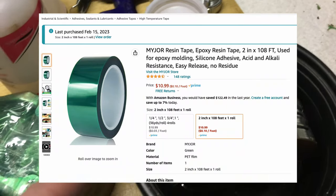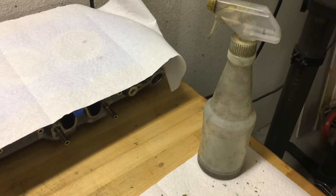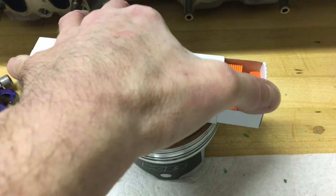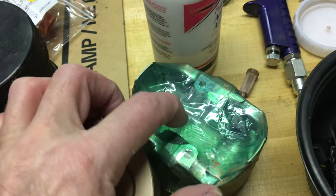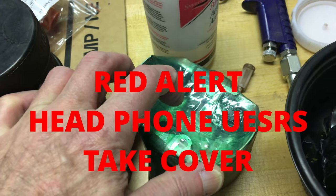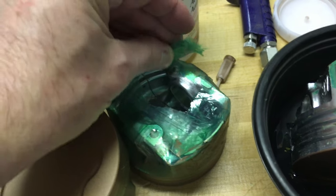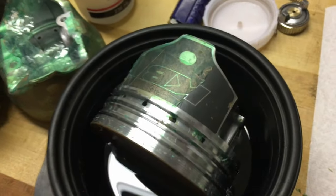You can see I'm in various stages of getting this silicone tape off. It's a high heat tape that stood up real well in the oven at 500 degrees Fahrenheit, but getting it off is no joke. What really works best is these little plastic razor blades — you just got to get in there and chip it off. When it cures in the oven, it kind of almost turns to glass. On the areas where the anti-scuff coating is, it really hangs on for dear life.